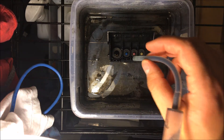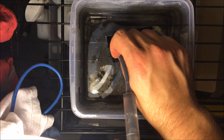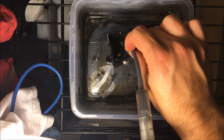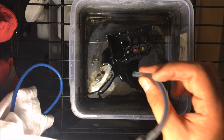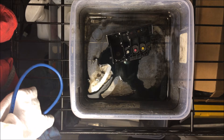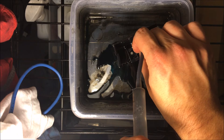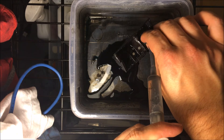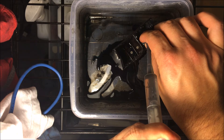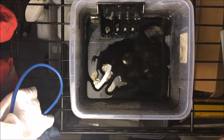Once you have your syringe, you're going to have some fitments — you put it right over here and just push right through. You're going to have instructions that tell you to warm up the solution; you can do that, but I usually have pretty good luck without that. I've used pretty much all my syringe on both of those nozzles, so don't be afraid to use up all the cleaning solution — it's pretty inexpensive. Maybe buy an extra cleaning solution bottle to have enough. I'm going over each one — now going over yellow, which is the last one. If you notice here on the bottom, that's a bunch of ink that has just come out — that's exactly what you want. That's how it should look.